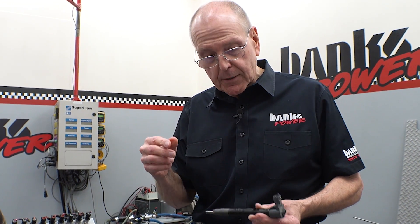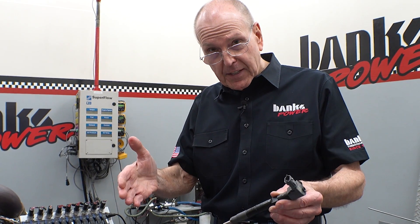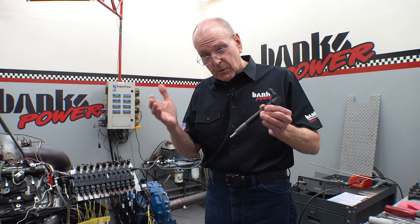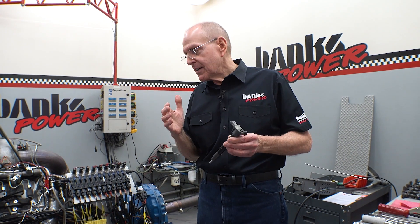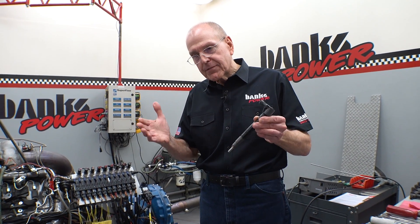Why are we changing the injectors? We just made 711 horsepower at 3300 rpm and the injector had to be open for 39.3 degrees of crank rotation to get the necessary fuel in. I want to do three things: make more power, but I have a rule about crank angle versus injector-open duration — I don't want to go beyond 40 degrees. Beyond that I've found I can harm the pistons, create really high EGT, and that's detrimental to the turbocharger turbine housing and the exhaust valves. My rule of thumb is 40 degrees.